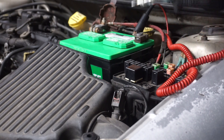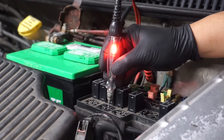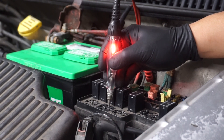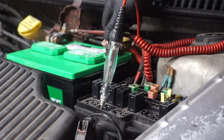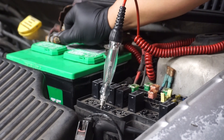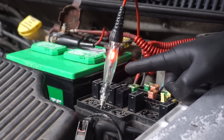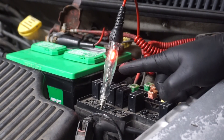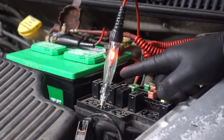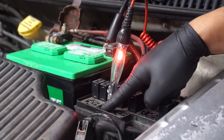I got a good power here. I'm gonna take my relay out and see where I have good power. You can see right here on this pin I got a good power source. Directly across from it I should have a good ground which comes from the fan. Let me switch my test light clip over to battery positive — I should have a good ground on that pin. And I do have a good ground. The reason that took a little while to light is because it's going through two of those fans and that's a lot of resistance, so it takes a while to find a good ground. That tells me that my fans are intact. If I use a voltmeter, I can check the resistance at this pin and that'll tell me the resistance of those windings on the fans. So I got a good power feed and a good circuit at the fans.